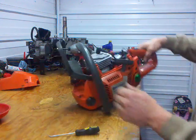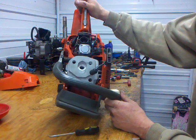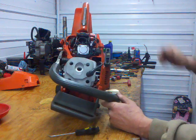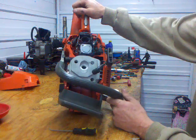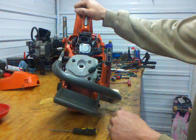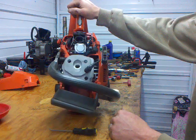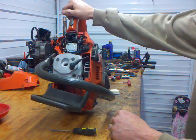This one has a Walbro carb on it. Had a lot of issues with these on the main jet nozzle. I'd recommend switching it out to the Zama if you have the means to. It just gets rid of any issues down the road. I'll put the part number in the description for the Zama carburetor. It's a pretty easy swap. These saws are pretty easy to work on.